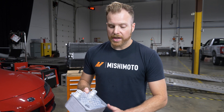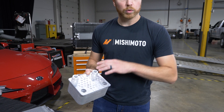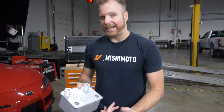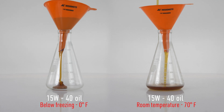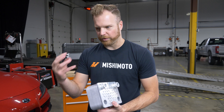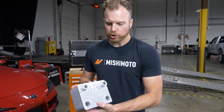One of the downsides to this is that it does use your engine coolant in order to cool the oil or the transmission fluid. But the flip side of that is, if you live in an area where it gets extremely cold, it works in reverse — it heats that fluid to get it up to its optimal operating temperature faster, so you don't destroy your engine because your oil is really thick or your transmission fluid isn't flowing easily throughout the transmission.